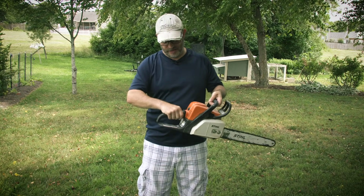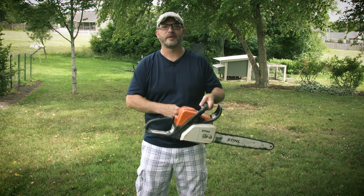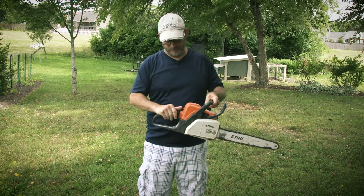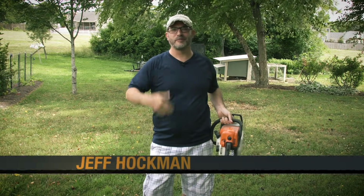See, there, I wanted to do it again, so I'll take it up to the on position and do it. Okay, I turned it off right away. So there you go. It's that easy just to start it. Pull it until it burps on full choke, take it off full choke, and it'll start right up for you.